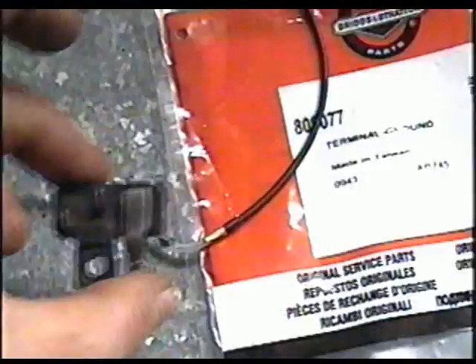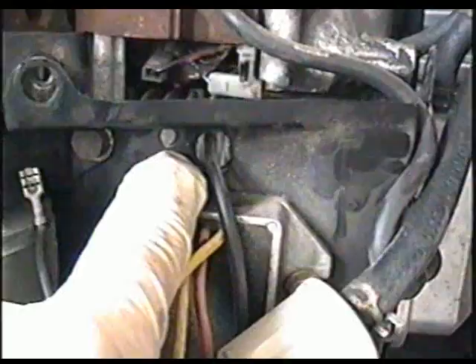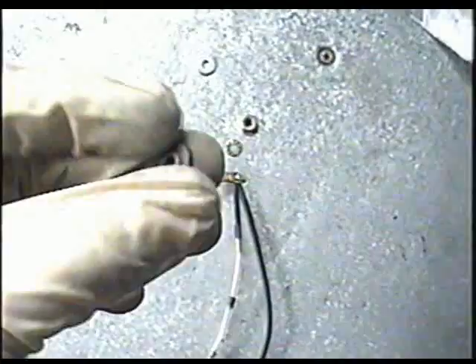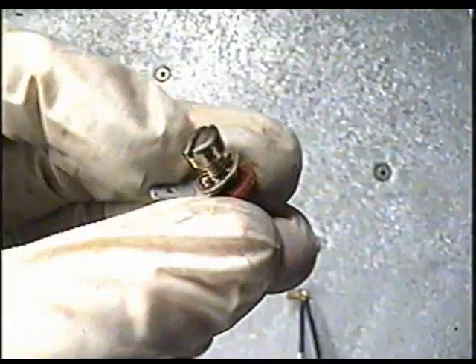So that's the culprit — just a little wee part like that, superseded to this. I read the instructions in the parts bag, and it said to drill the hole in the cowling to a quarter inch — it's about 3/16 right now, so I'm just going to drill that out. I think the reason for that is because of the insulators that came with the new kit. So I'm going to reinstall that now and just do it as the instructions say. First of all, you've got to put a tab in near the screw, then an insulator, then insert that into the cowling. Next you need to insert this little insulator as well, and you point this side toward the head of the screw.